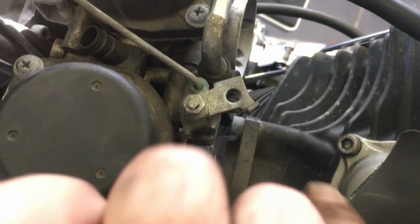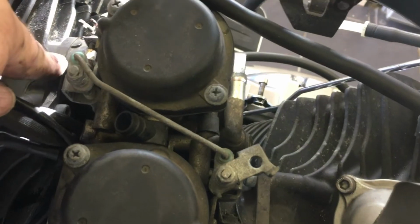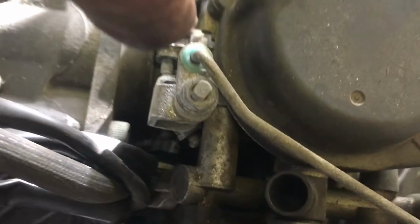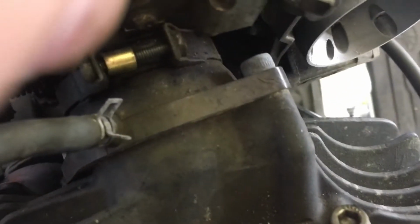There are 4 electrical connectors towards the front of the carburettor which need now detaching. Each of them have a separate style of connector, so it's impossible to reconnect them incorrectly. Right, nearly there now. We've got the rubber hosing connectors, and there is an Allen key screw on each of the metal retaining clips.